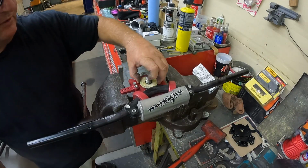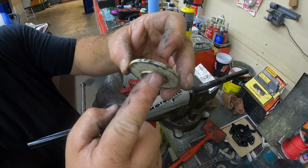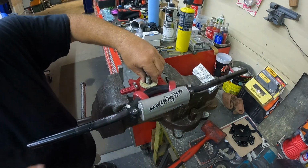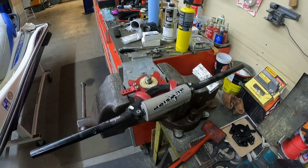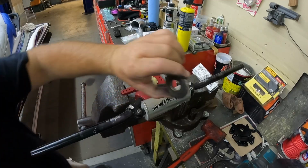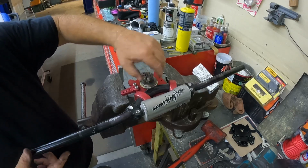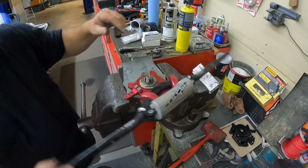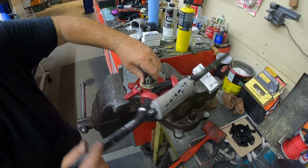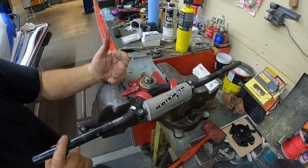So what you'll have to do is put these 750 bushings on a sanding wheel, and see this depth here? We need 1/2 of that. And as you can see, this is our 650 top washer. They're the same diameter. But now that you have all that in place, you can run a cotter key through there, and now you have a really modern upgraded steering system.